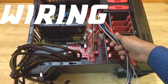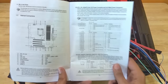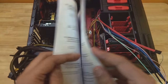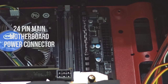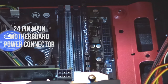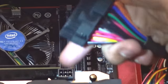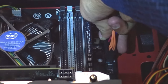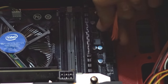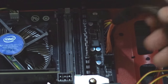Now it's time to give power to everything inside your motherboard and CPU cabinet. This part, called wiring, is the most complex part in building your PC. Before wiring, take the manual that came with your motherboard and have a quick look because you'll need those manual scripts to connect some wires. Start the wiring process by connecting the main ATX 24-pin power connector to the motherboard. This is the largest pin in your PSU connector — it's going to power up your whole motherboard. Find the 24-pin matching slot on your motherboard — it will be a really large connector and easy to find. Grab the connector and place it in position carefully.